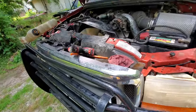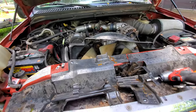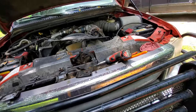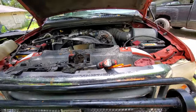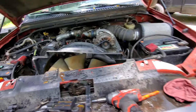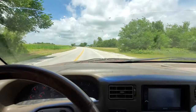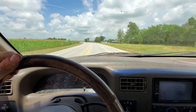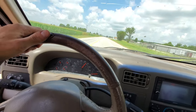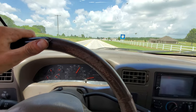It literally took me like five minutes to disconnect. So I'm going to put this one in, fill it with coolant. I've got to address a block somewhere in the AC system too. I bought a receiver dryer and an orifice tube — I'm going to replace those and see if I can get it to work. The AC compressor seems to work just fine; it builds pressure, it just gets really high on the high side. The radiator seems to be working fine. The running issue seems to have gone away — it accelerates fine, no hesitation. Probably just water in the fuel somewhere.